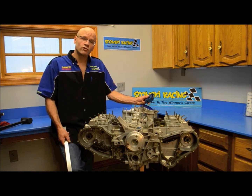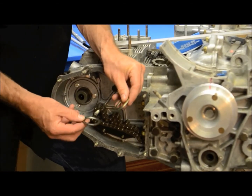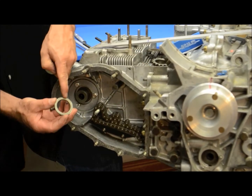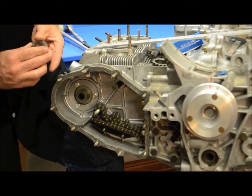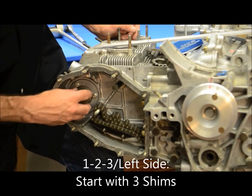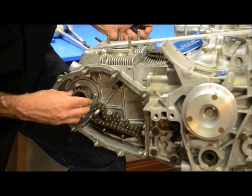In order to demonstrate this tool we first need to set the engine up. The first step is to set up the sprockets and add the thrust washer and the shims to where they belong. The thrust washer goes in first with the bevel side facing in, and on the left side we usually start by putting in three shim washers. We leave the Woodruff key out — this makes it a lot easier to add shim washers if we need to.